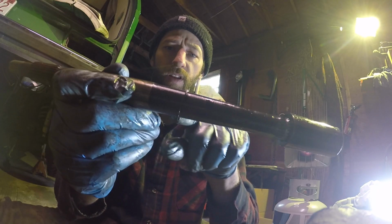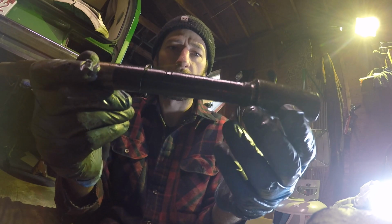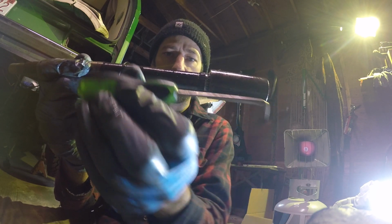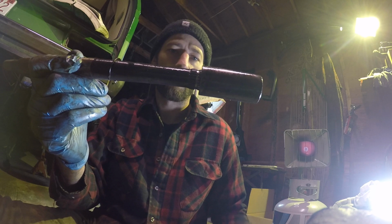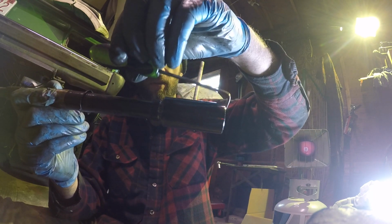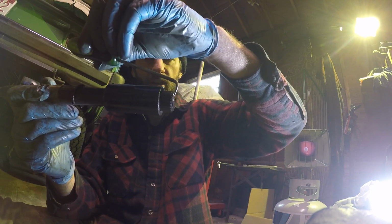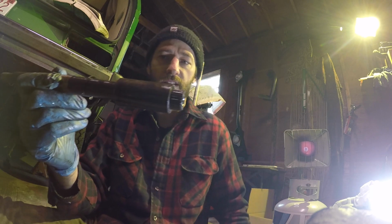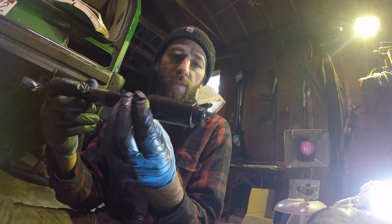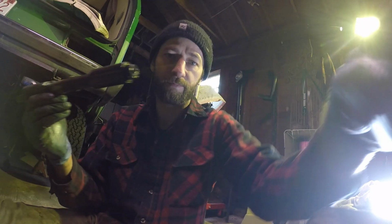You're going to take this circle clip and move it as far forward as you can towards you. And then you're going to take a little pick, which is what I use, and I hooked around here in the back and pulled it forward towards me, exposing this joint here. Once this is unlocked, you're able to turn it. And to loosen it, you're going to be going counterclockwise.